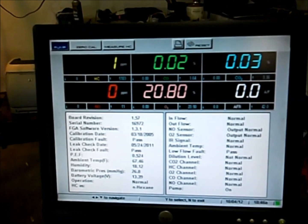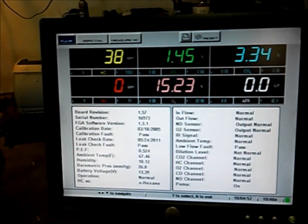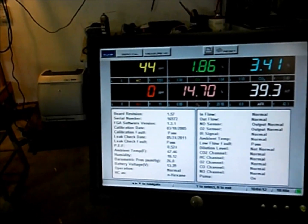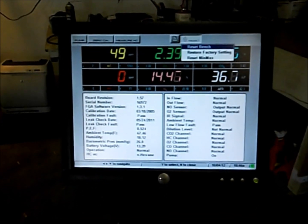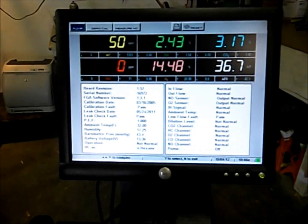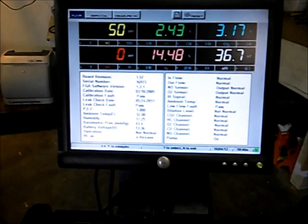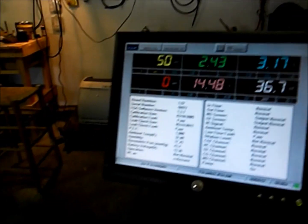This is the unmodified engine. It usually takes about eight seconds and then it starts to populate — you can see the hydrocarbons coming up. It's reading a high of 5103, which is not right. It's supposed to clear out the existing numbers, so let's reset that. I think we've got some good numbers there to go with now. I'm going to stop a minute, write these down, then adjust the spark plugs and see what happens.